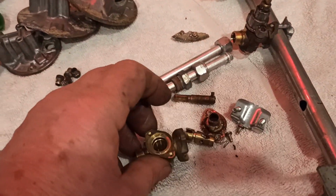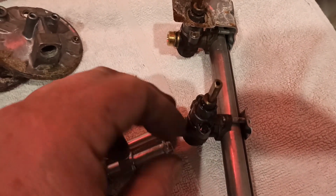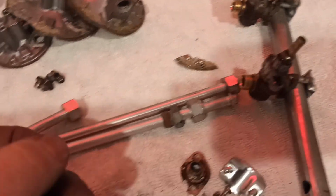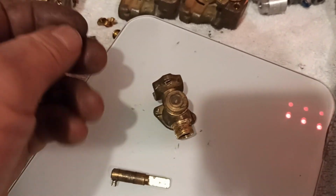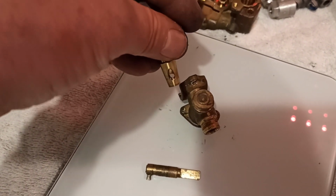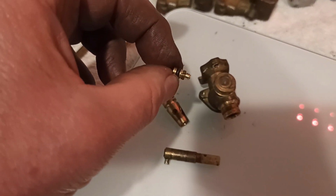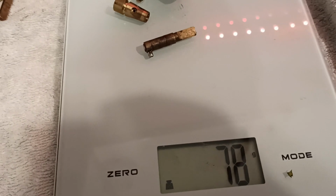And the cheap machine has only got very little in there, very simple valves. All you got to do, undo the 2 Phillips head screws off the top. The steel bonnet, not alloy, separates from the spindle, and when you pull it apart, there's the valve body, there's the spindle there, there's this cone-shaped device. I don't know what you'd call that, but that's obviously assists in regulating the amount of gas that goes through that valve. And there's a little orifice, I guess it is, down the middle of that one that has an O-ring on it. Take it off, leave it on, that's up to you. I take mine off. And there's a lousy 78 grams of brass there.